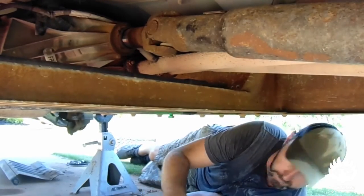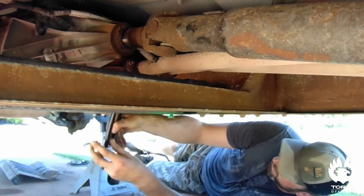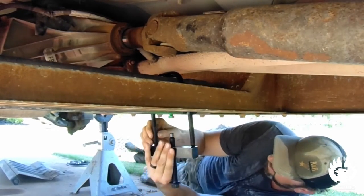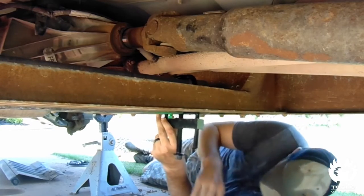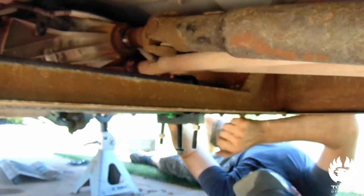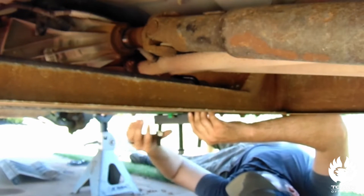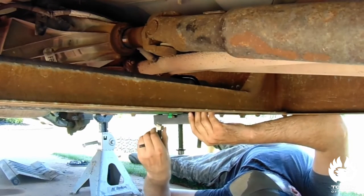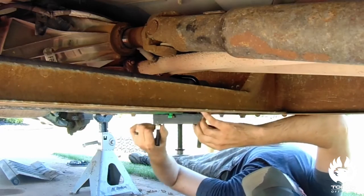Roll this up over the top across your crossmember, heads down like a horseshoe. Bring the block up — it's extremely simple. Run these nuts up, run this block up as far as it'll let me. It's gonna pivot back and forth when you're tightening this, but it works fine. I've already done the other side and this is a really good tool. This hoop acts as a safety in case that torsion key comes apart — it's not gonna let it fling off. It came with the kit.